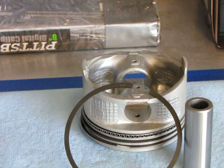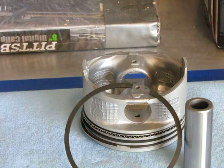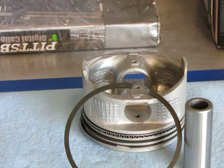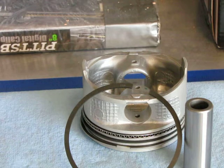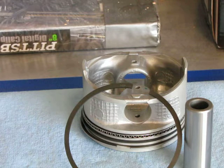The reason for that is these are the compression rings, and the compression rings also scrape the oil down off of the cylinder walls as the piston goes back down after being oiled by the oil from the oil pump. The oil rings at the bottom of the piston rings oil the cylinder to lubricate it. This ring scrapes that oil down to keep an excess amount of oil from being in the combustion chamber and burning oil.